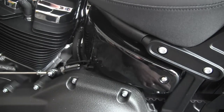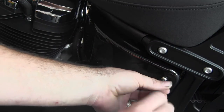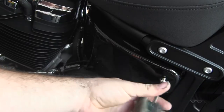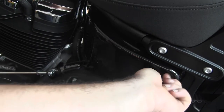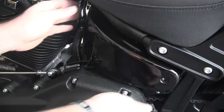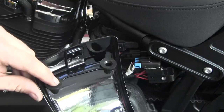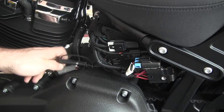So I'm just going to show you where some of this stuff is in case your dealer didn't give you a brief overview. Take this and pull this screw out right here — this panel is only attached with this one Allen head screw, and then it has these push-on little rubber grommets behind it. You just grab it, work it off a little bit. You can see a grommet here, grommet there — it attaches to these metal posts that just push on.